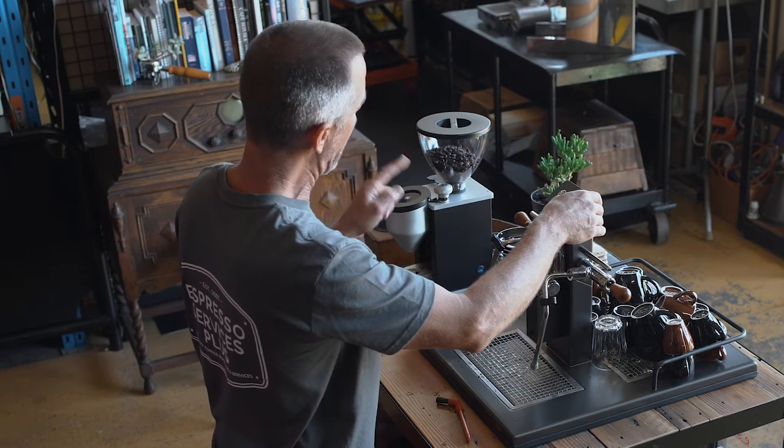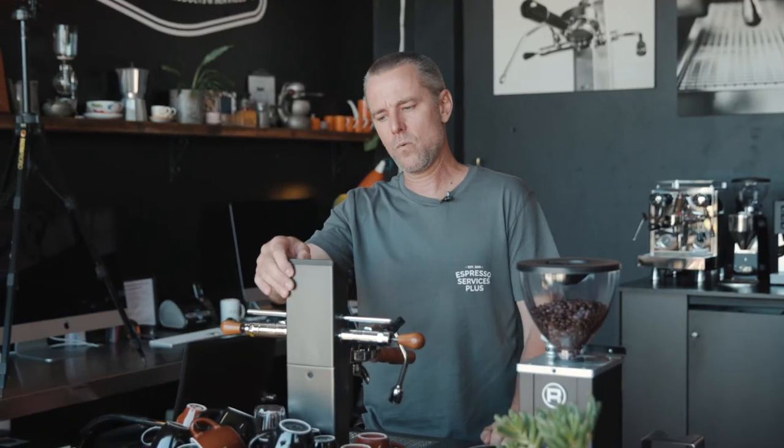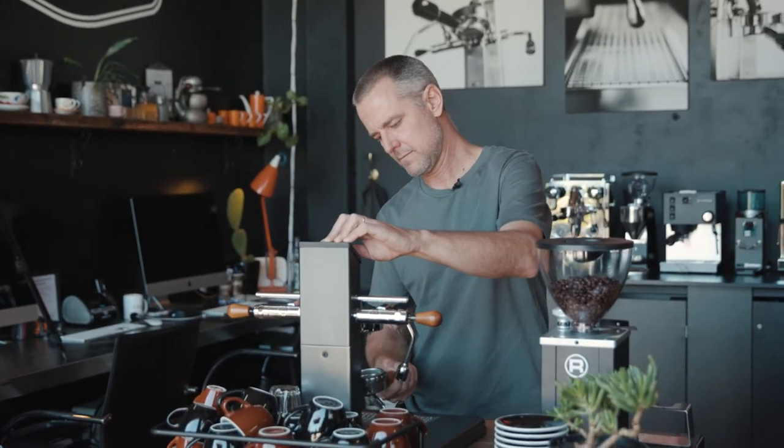It's also important after doing those six times to make one espresso and let it go to the drain — throw it away, discard it. That way you've got a nice clean group head, able to taste fresh coffee once again.